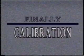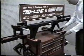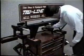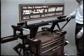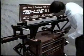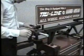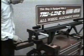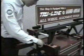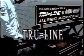Finally, the video shows how to calibrate the system. To avoid comebacks, an alignment system must remain in calibration. With the TrueLine system, the technician can verify calibration in seconds before each use. He verifies that the laser beams are centered, compares the camber scale to the master level, and checks that the camber scales are opposite each other — and that completes a calibration.